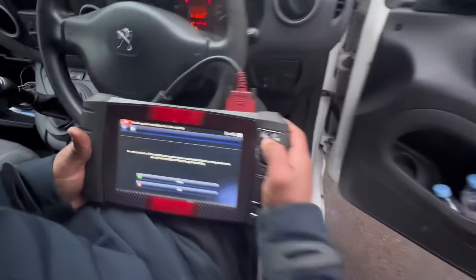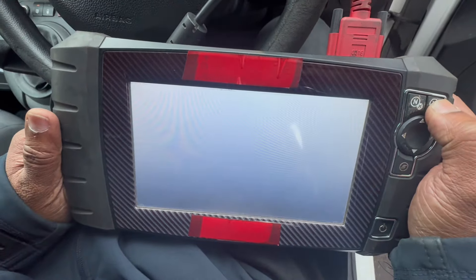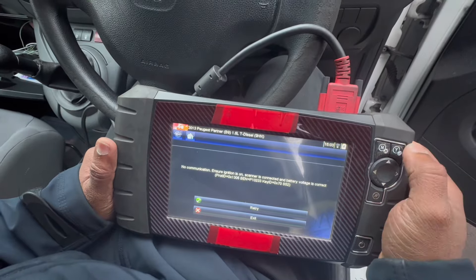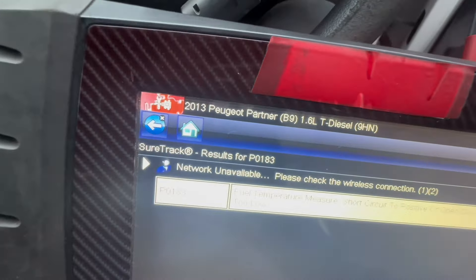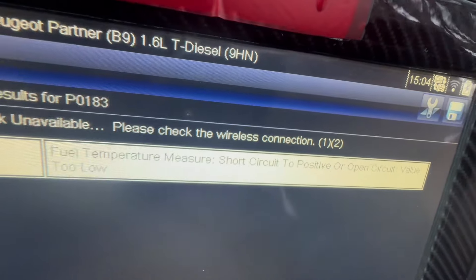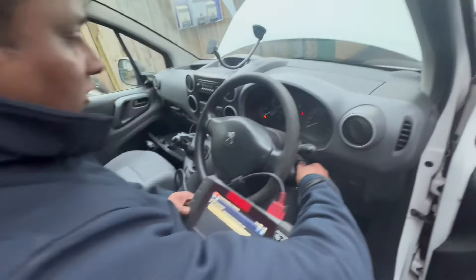Before that I'm going to try to reset the light if I can. This is the fault codes you saw earlier - I'm going to delete all four codes. Turn off the ignition for approximately 10 seconds and continue. Again I'll pull up the engine codes - you can see anything left is only the fuel temperature sensor code. However I'm going to do the cleaning process first and come back to that one, because at the moment parts are not available. I'm going to start the car.